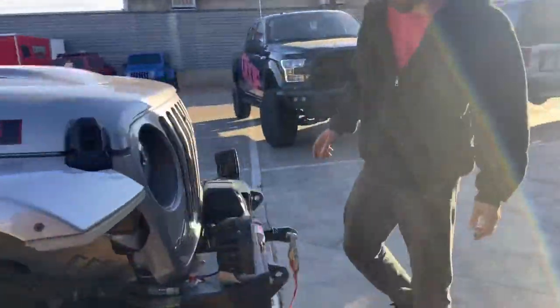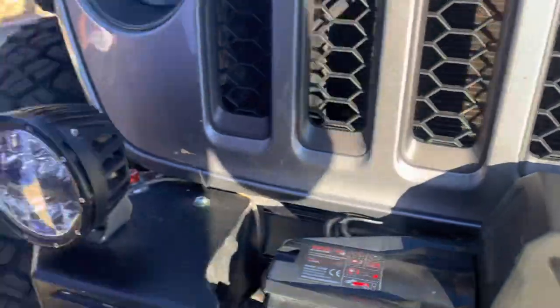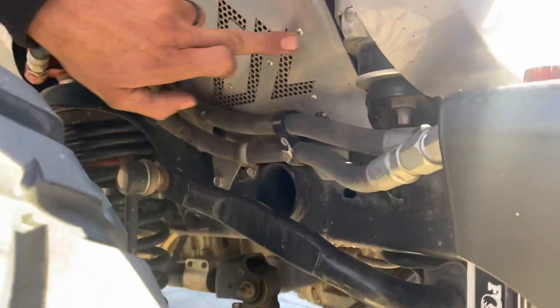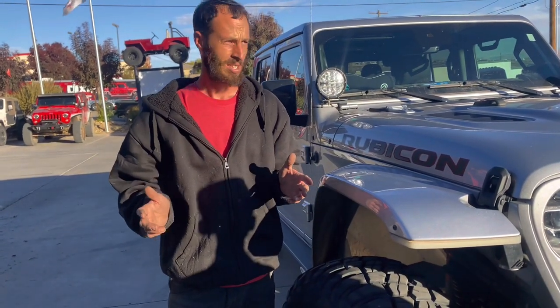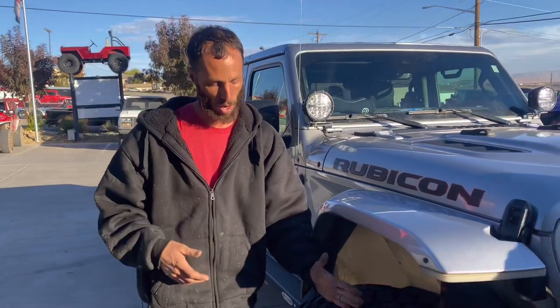One other feature that's kind of out of sight, out of mind — peek your head in here and there's a cooler in there. What's even neater: this Jeep has an electric power steering pump tucked in behind the inner fender. Your steering is actually electric. We put a gauge on it and turned up the factory pump to close to 2,500 pounds. That extra boost helps with steering when you engage the front locker or run a more offset wheel like this.